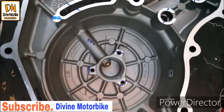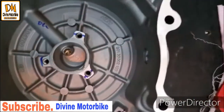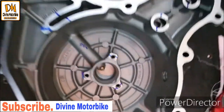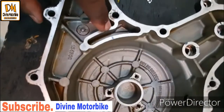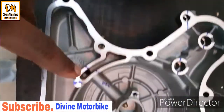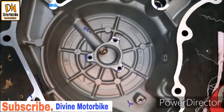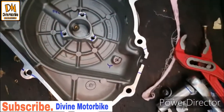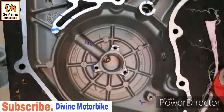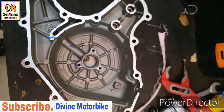What this oil injector does is supply oil to the stator coil to keep it a little cool, so it lasts a bit longer. That's the difference between the BS3 and the BS4 in terms of oil supply. The oil supply is taken from here, and the cutout is the same. So under high stress conditions — like really long rides where the engine is constantly at heat — the coil on the BS3 would just die midway through the ride and ruin your riding experience.